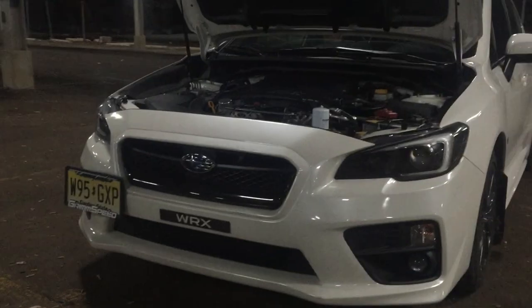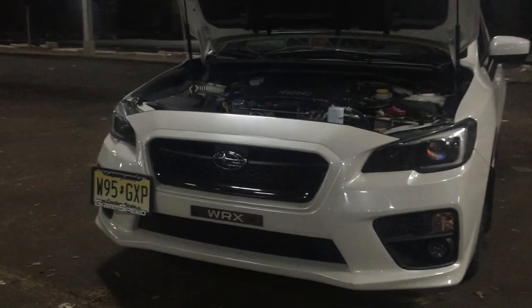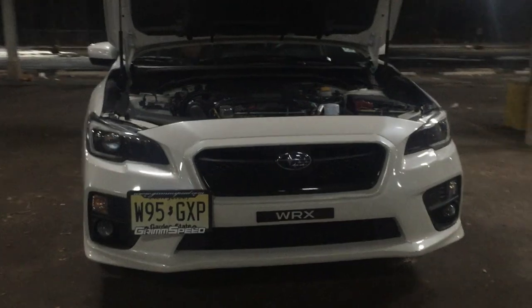The total list of things Danny has on his car to make 330 horsepower: he's pushing 22 PSI. The mods are TGV deletes, EGR deletes, catless downpipe, Invidia catback, intake, Grimmspeed boost controller. And I think that's pretty much it. To wrap up this video — that is how you Stage 2 your Subaru WRX.